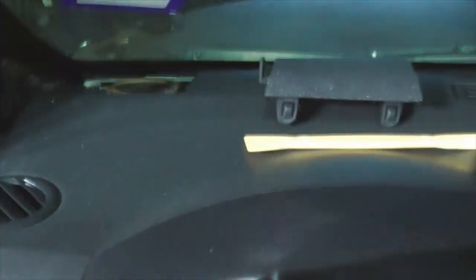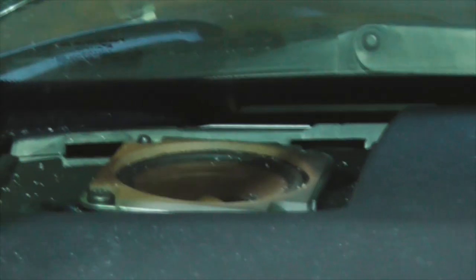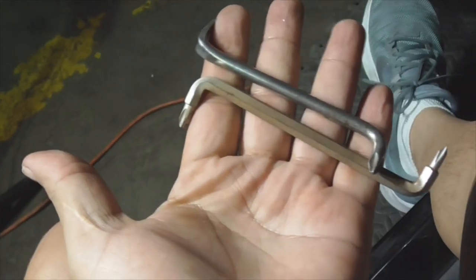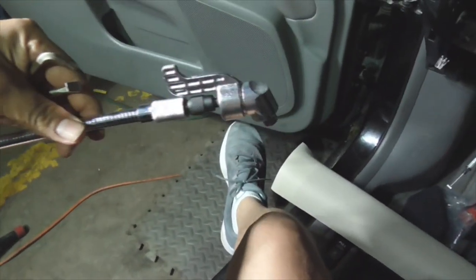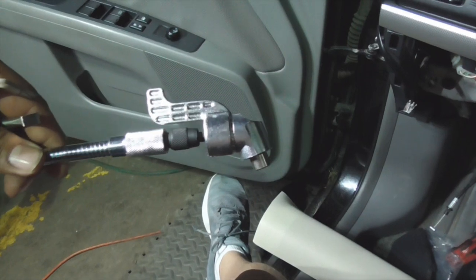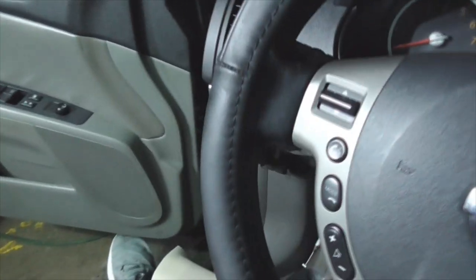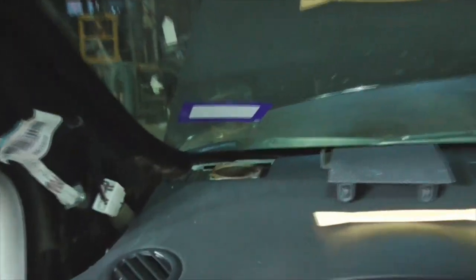From there it's pretty straightforward — looks like it's got two Phillips head screws and should pop right out. To get at those little mounting screws, the one towards the front might be a little more difficult. It's hard to see and the window makes it hard to get your hand in there. I've got a couple of little L-shaped screwdrivers and also a 60-75 degree bit holder to get in there and get those screws out. You can also do it with low-profile L-shaped screwdrivers — just a couple tips.